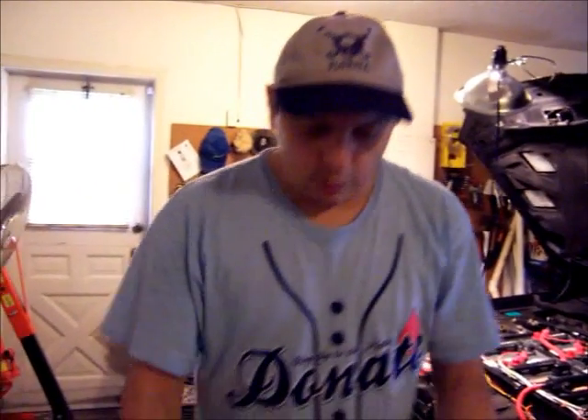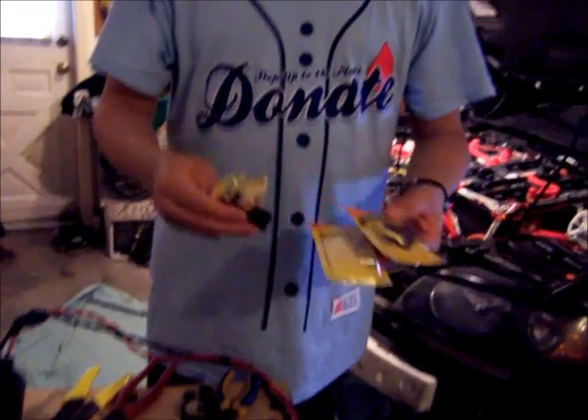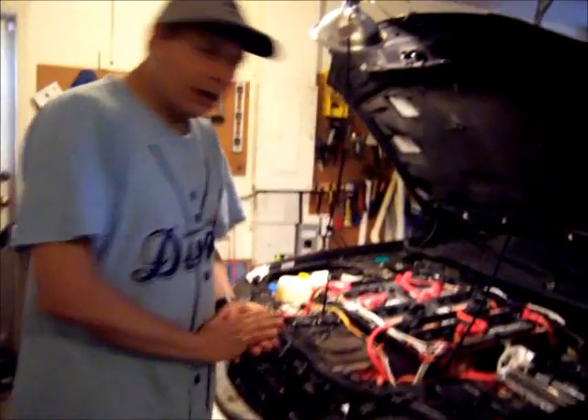I've been working on my cables and my supports, and I have a couple of fuses. I'm going to use two lines of 30 amps each. So I have two fuses, two relays, and two cables going to the power steering. I'm going to show you the supports under the car.